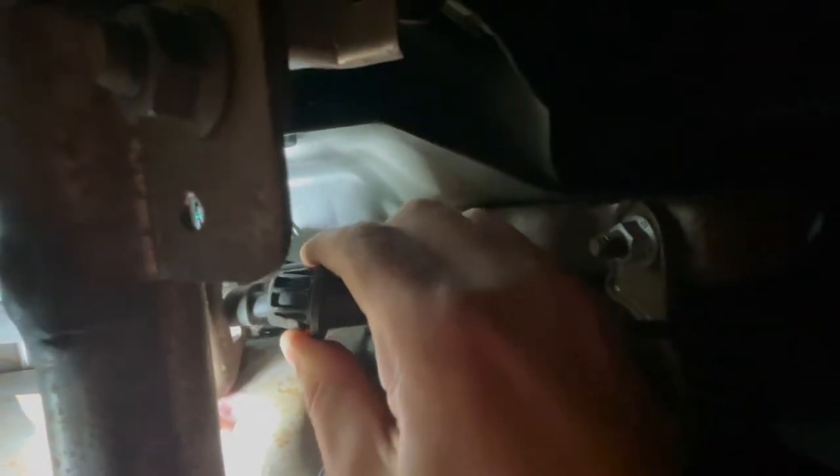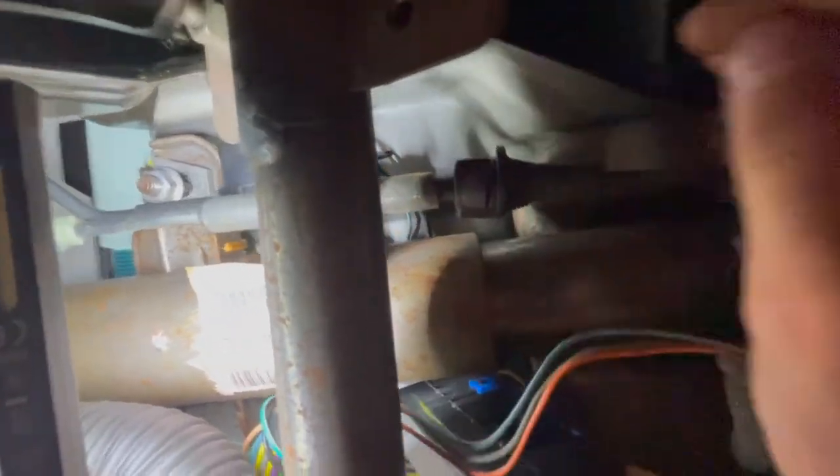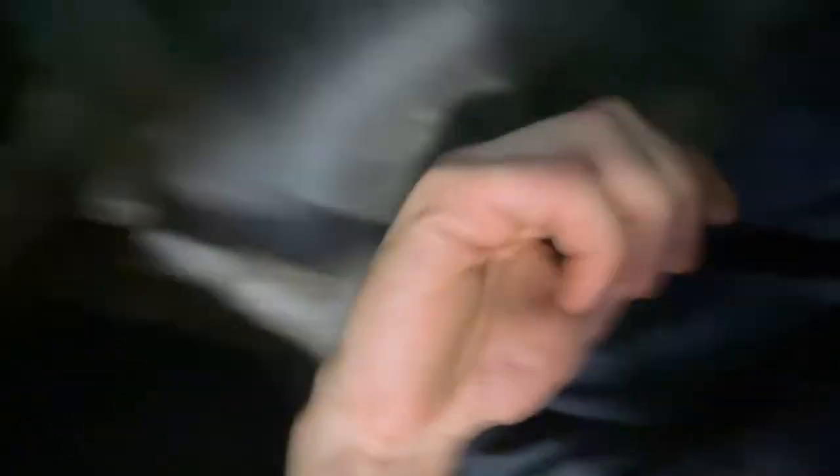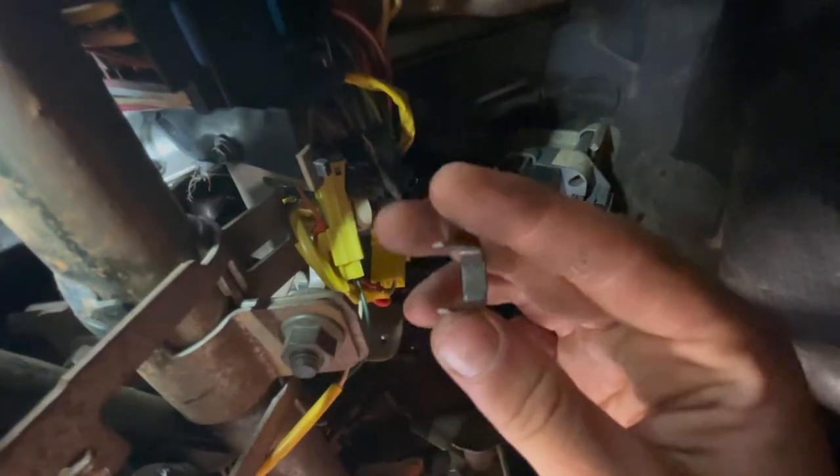Cable is removed. I was having trouble holding the tools and the camera at the same time, but to show how this works - this part of the cable is up at the column, but if you come down here there's a loop. If you look at the side of it, these two tabs come out. You need to pop one in with a pick - I used a 90-degree pick - pop it sideways, shimmy it, pop the other side of the clip, and then you can pull the cable out of its loop. There's also this locking clip you have to pull out first before you can compress those tabs.